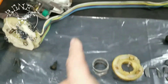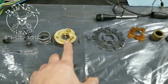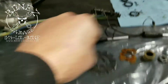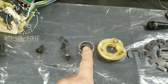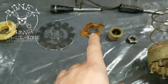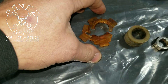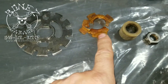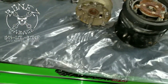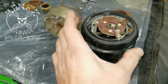There's a rod that goes down the shaft to push the high beam button — you hear a click. Here's the part for your horn, and this is the actual steering wheel lock so when you turn the key you can't turn the steering wheel. This is the retainer or cushioning spring for your steering wheel. This is also part of your turn signal stuff — as you can see, the nylon has gotten so old it's like Bakelite and has just cracked and disintegrated. We're going to be replacing a lot of this.